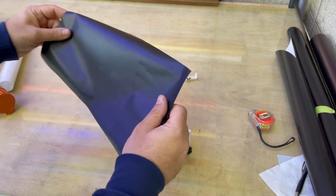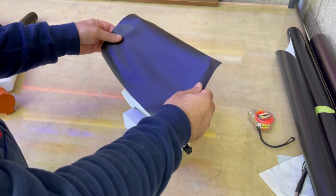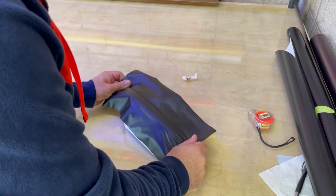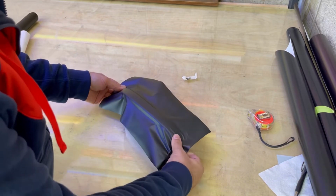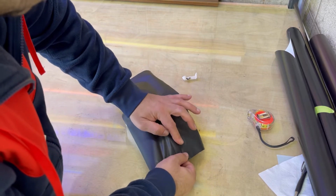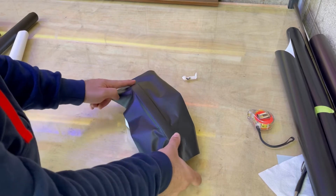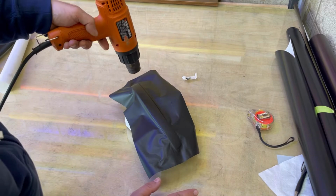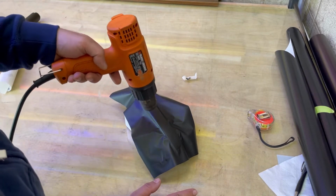Okay, the first important thing: don't use any heat gun or anything, just do the pre-stretch like this and fix those front ends. Okay, since you do it like that, and then I always say wrap to the left and right, the film already got the shape of the door handle.